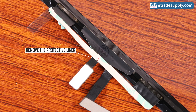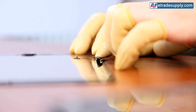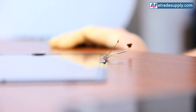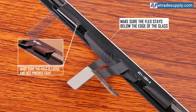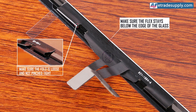Remember to peel off the double-sided adhesive seal on the digitizer flex cable. Pay attention while gently bending the digitizer flex cable — you only want to make a small loop and not actually fold it. The digitizer flex ribbon is very fragile and you need to handle it gently, making sure that the flex cable is not flattened. While lining up the flex cable with the edge of the screen, pay attention not to allow any of it to poke out beyond the screen.